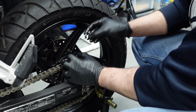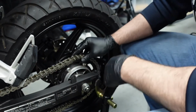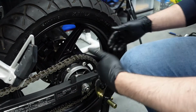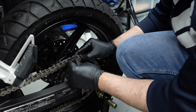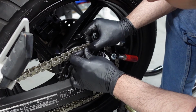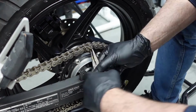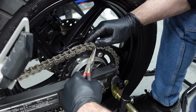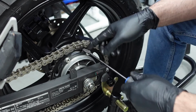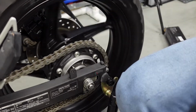Put the two O-rings on the link. I got it on after some struggle. But there's still some slack, which is good, because I'm able to stretch the chain a bit. Then the link cover plate. Okay, so I got one end of the retainer clip on there. Alright, got it in. Make sure the clip is going that way, like an arrowhead. Okay, chain is on.